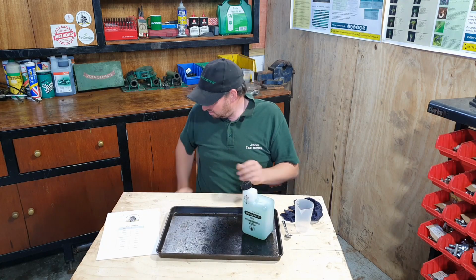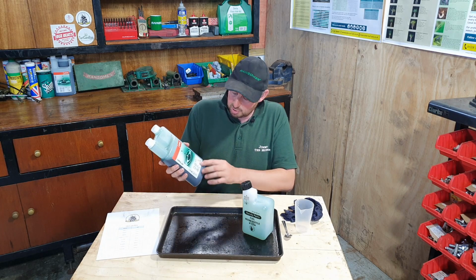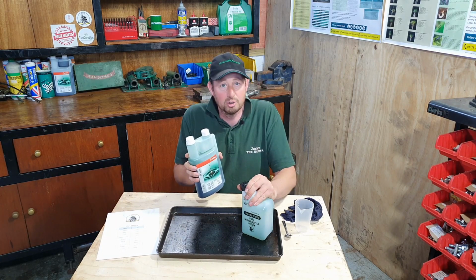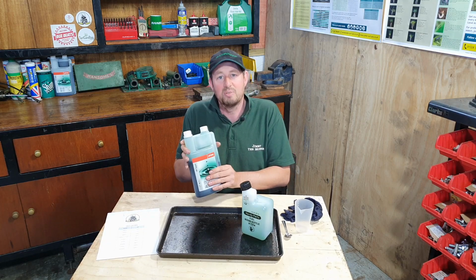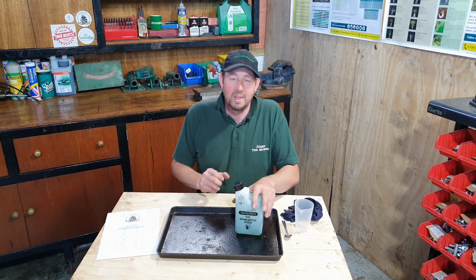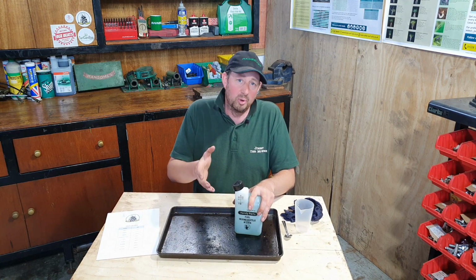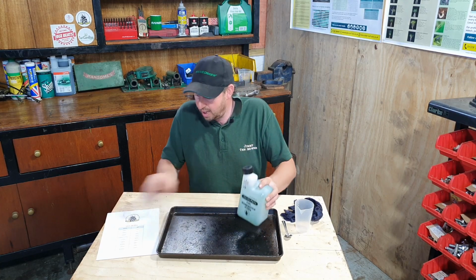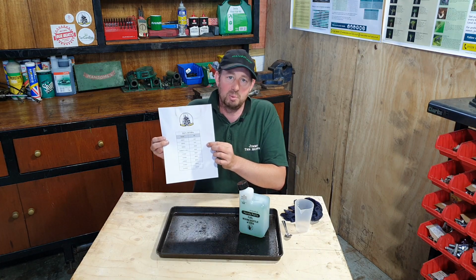I highly recommend using this Stihl oil because it's a synthetic oil, fully synthetic, and there's also a fuel stabiliser built into it. So if your containers aren't 100% vapor tight, it will sort of keep it a bit fresher for a bit longer. If there's anything more you'd like to know about mixing fuel, the different ratios, there's also 40-to-1, 32-to-1 and 25-to-1. It's all on these handy bottles. However, I'll be putting some more of these sheets on my website, and they are available to download.